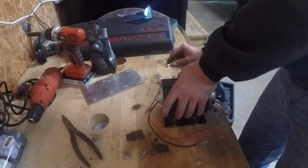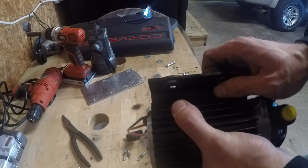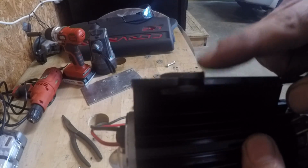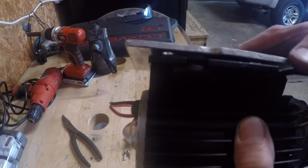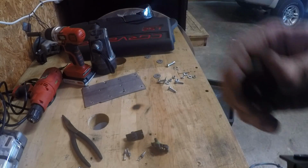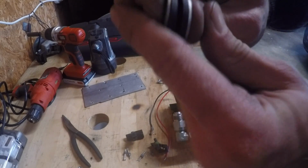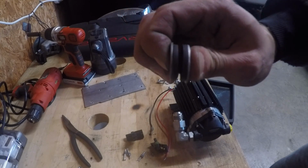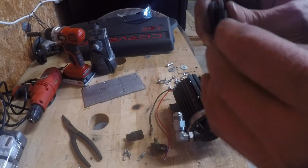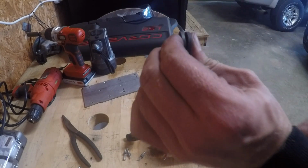Well, that's important because to insulate the pump from the metal frame and from any sort of vibration, there are these rubber grommets that are a certain size. You can see there's some amount on the back here, so even whenever I mount my plate to it, there's still going to be some amount of space between my plate and the pump. These rubber insulators don't need to get squished down. If I pinch it between two things, I can squish that and eliminate the space between my pump and whatever I'm mounting it to, which is why these little spacers come in so handy. They fit in there, and they're just a tiny bit smaller than these rubber grommets so that I get some bite on these rubber grommets, but I don't squish it.